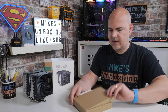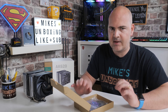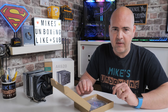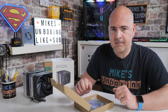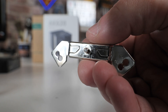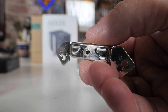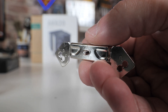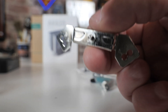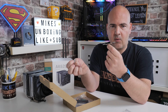So let's start with the accessories box. This is really good — harking back to what I said earlier, this is probably going to be one of the easiest coolers you've ever installed. In our first bag we've got the AMD fittings: two brackets. Something really nice about these brackets — Deepcool have done a fantastic job. Quite often with wing-style brackets you're not sure which way round they go, but they've actually printed an arrow on the metal itself saying 'CPU', so as long as the arrow points towards the CPU, you know it's the right way. I like that a lot.